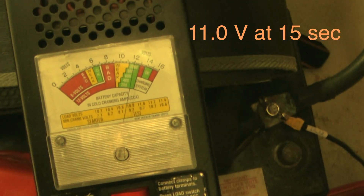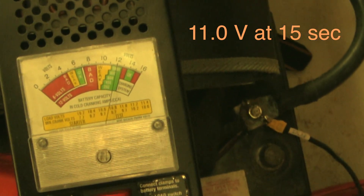So the starter is the best of the three, and the weakest is the one on the far left — I'm going to take that one home. Even though hydrogen gas is very different from propane in that it's very light and unlikely to stay in a confined area for very long, some would argue we shouldn't do testing within the small confines of a boat. If you're at all concerned, especially about overcharged batteries, the safer approach is to pull the batteries out of the boat and test them in a well-ventilated area. But I think the way I did it is pretty safe — I used a method that caused minimal sparking, I was wearing safety glasses, and I haven't had a problem.